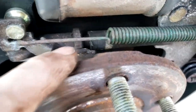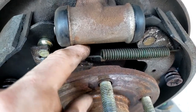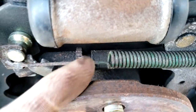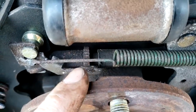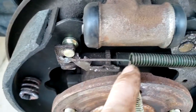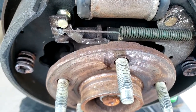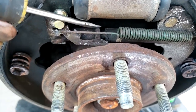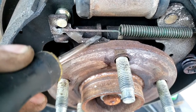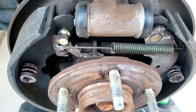These self adjusters have a little cog with teeth going almost one direction, so with a flathead screwdriver you can actually adjust it manually by moving it one way or the other. Looking at the threads — if we move the wheel downwards, the shoes move outwards; moving the wheel the other way causes the shoes to retract. The car should do this by itself, but there are times when things get seized and you need to clean it up, free it up, and set it — then it should be able to do it itself.